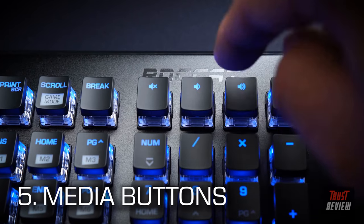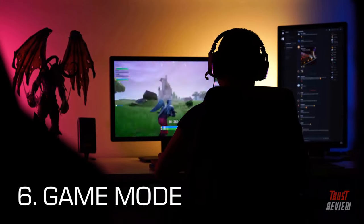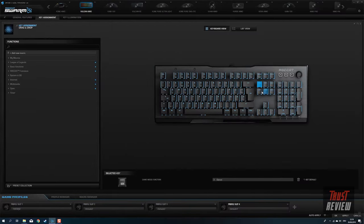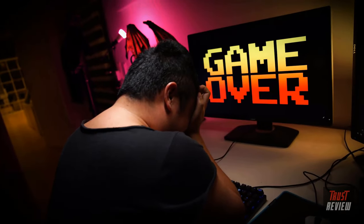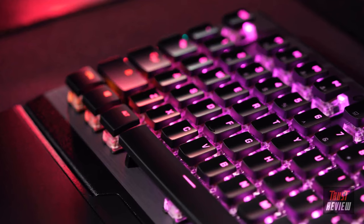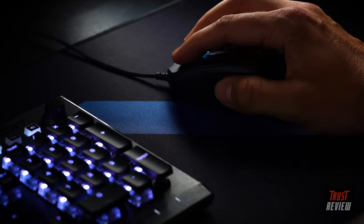The Vulcan 80 is equipped with multimedia keys for volume, mute, and illumination brightness. Other Vulcan models add mixer-style controls for quick on-the-fly adjustments. Game mode is activated by pressing the FN key and scroll key — while on, navigation and editing keys work as macro keys, customizable in the free driver software Roccat Swarm. Game mode also deactivates the Windows key to avoid accidentally tabbing out. In gaming mode, you can double the functions of your Vulcan with Roccat Easy Shift, assigning a secondary action or macro to every button on the left half of the keyboard, activated with Caps Lock.